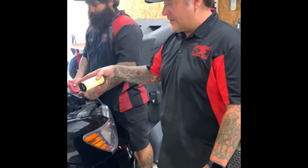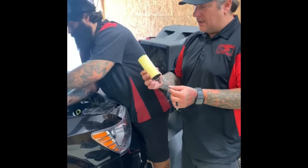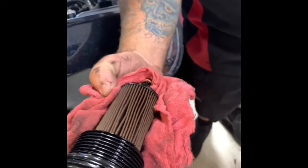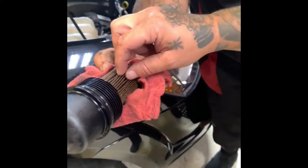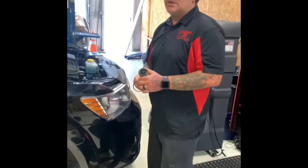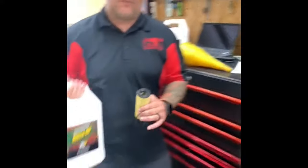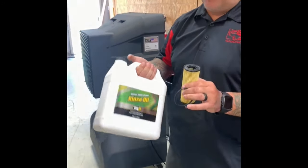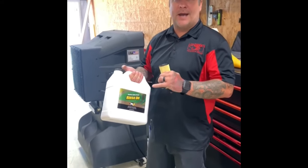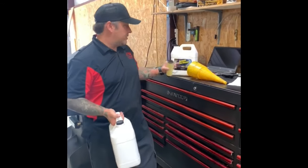We're back now doing the top-side oil filter. Here's the new one, and here's the old one — obviously it's a little warm. We're excited to cut this open; this is what filters your oil and catches all the debris in a normal engine. We're going to change to a new filter and then pour in our rinse oil. This is another six quarts — the rinse only runs for 20 minutes at 3,000 RPM. This should clean out all of the cleaner that we just ran.